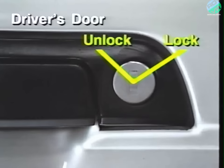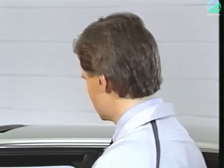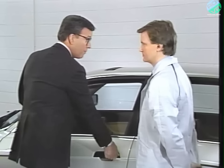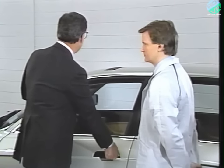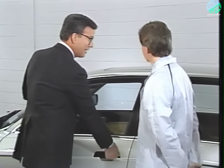From the outside, insert the key into either front door, turn it to the first position, and lock or unlock all four doors, the trunk and the gas filler flap. And when you've locked the system this way and unlocked the trunk, all four doors open. You can close the windows or the sunroof when you lock — just hold the key in the locking position, and the job gets done.